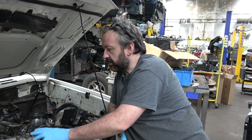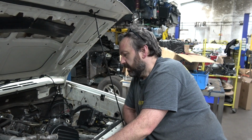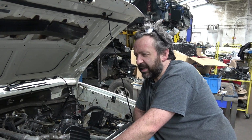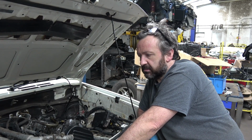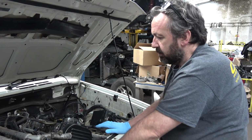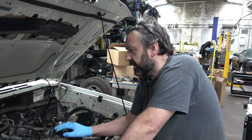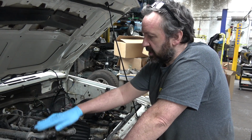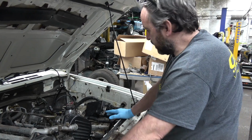Sure. Did a lot of research because you can basically bolt the LT4 supercharger onto the L86, the LT1. You have to put a spacer on, or you can rejig the head because it's a different sort of pattern. But then the front drive's not quite right, and there's loads of little bits and bobs, so it sounds quite cheap but then you end up adding up, and then the other route is turbos. I did an RX-7 twin turbo 12-13 years ago, which was very good, and I've decided I'm going with the truck engine, but I'm going to put some forged pistons in it, ring gap it, proper turbo cam, LT4 injectors, LT4 high pressure pump, which should give me enough fuel. I've got a car intake coming for it, so it's not the big high truck intake, it's a Camaro intake. And then I've done some brief calculations on turbos.